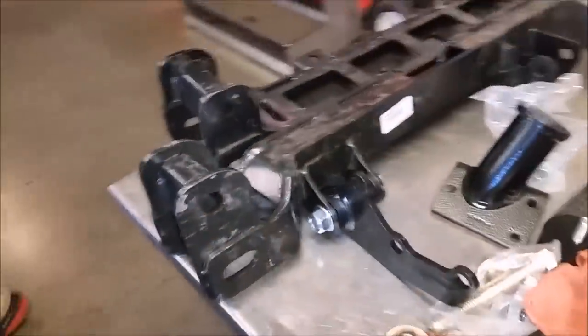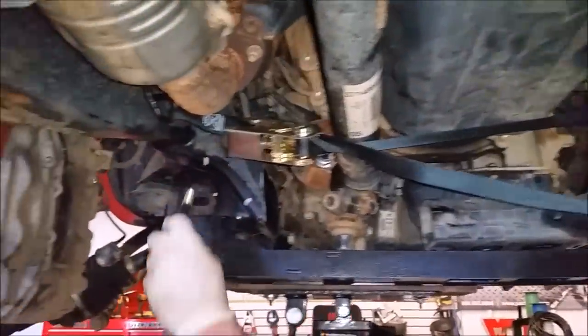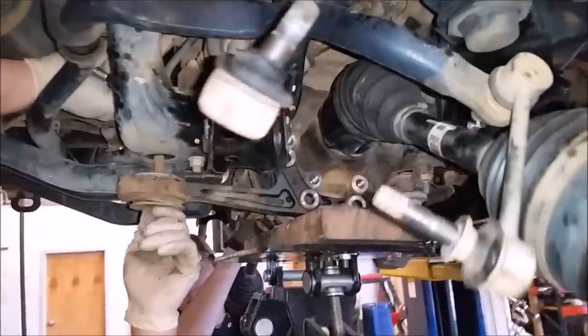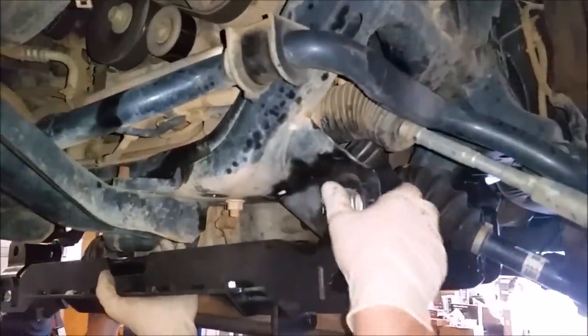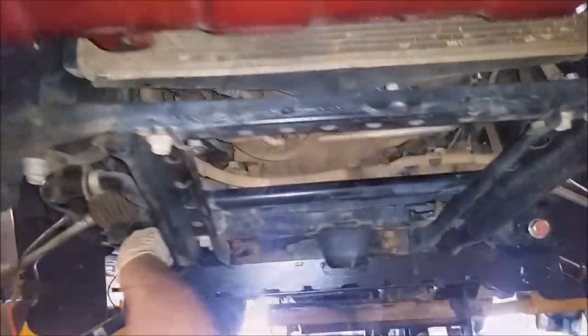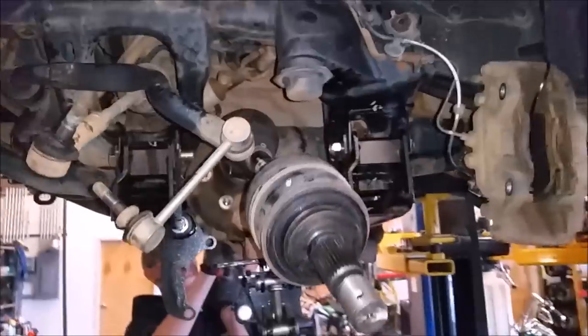So we're working on assembling the crossmembers. We've gone ahead and put a differential bracket on — here's the other one. We've gone ahead and used the supplied bushings to get these all squared away, and then the supplied bolts to mount them. Now we're installing the rear lower crossmember using the provided bolts from Rough Country, and it fits nicely in there. We're working on taking the right and left transfer case mounts off — just a few bolts holding it on. Now we're installing the front lower crossmember, using the bolts it comes with and then the nut on the back side. Both front and rear lower crossmembers are now installed.